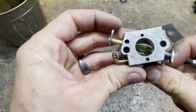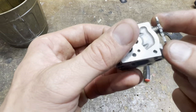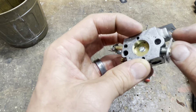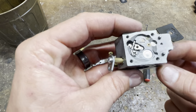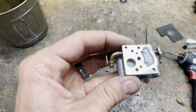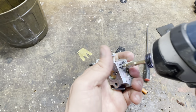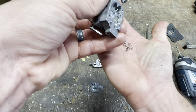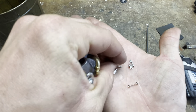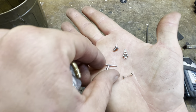This is not really spring-loaded anymore — that's odd. Normally these spring closed. That might be an indicator that someone was in here before. Whenever you run across things like that, think about whether someone was in here and did something wrong, like leaving a piece out, versus something that's just worn out — you're dealing with a different set of failure modes. In the metering lever system you basically always have five parts: the needle, the pivot shaft, the lever, the hold-down screw, and the spring.